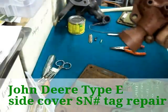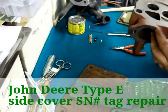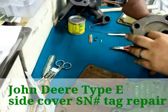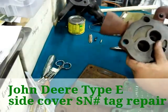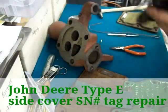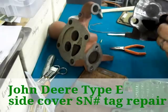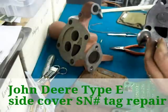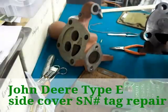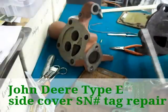These are two one and a half horsepower heads. This one looks really good — I did electrolysis this. I do have to cut the seats and put the new valves in; I do already have the valves. This one has been through electrolysis once and needs to go through again. These are some valves out of a car that I am going to try to use, maybe not in the first two I build, but on the third or fourth one I will try to cut this valve off, drill a hole through there, same length as the original valves.